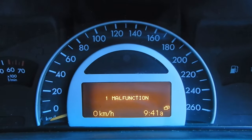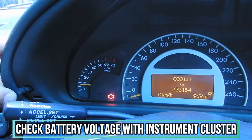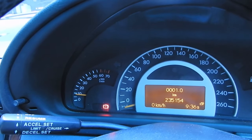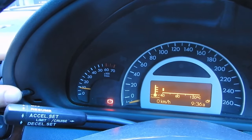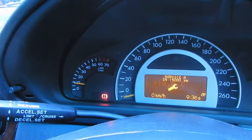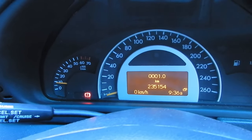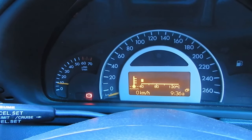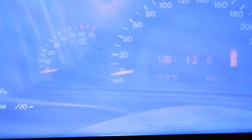To check your battery mode and go into the secret menu, go to your odometer and press the reset button three times. For some reason mine doesn't do that, but I do know for sure it works. I'll post a quick video showing how someone else has done it. As shown, the reset button was pressed three times rapidly and the battery voltage came up.